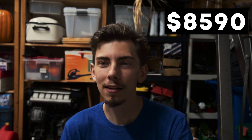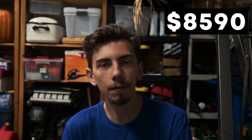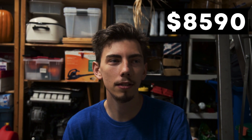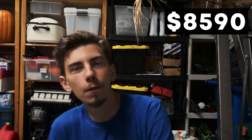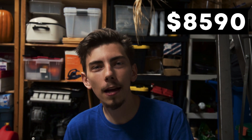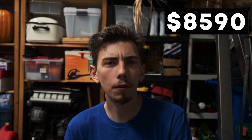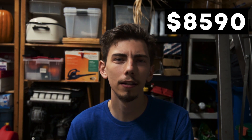For $350, I got ARP head studs — but I definitely should have skipped these. I'm actually running stock head bolts in the build now. You can make tons of power on stock head bolts, probably up to about 700 horsepower. There are guys who've pushed junkyard blocks to 700 on E85 with stock head bolts. It's probably not until after 750–800 that you'd experience head lift. Stock head bolts are about $50 — you could replace them seven times for the cost of the ARPs.